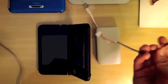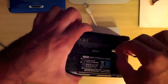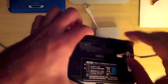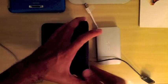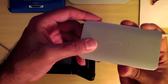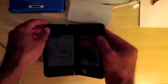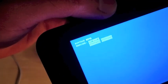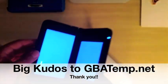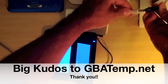Once everything's done, take your makeshift SD adapter and plug it into your 3DS XL first. Then take your USB SD card reader and connect the 3DS XL SD card to the card reader, and power on the 3DS XL. At this point you'll probably get a different boot ROM error message than I have, but disregard that — as long as you've got the blue screen to come up, you're ready to hook it up to your computer.